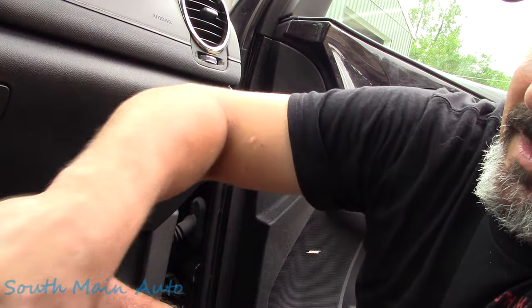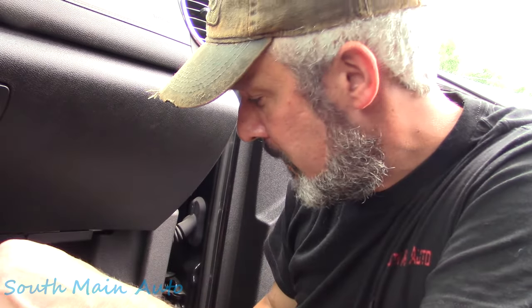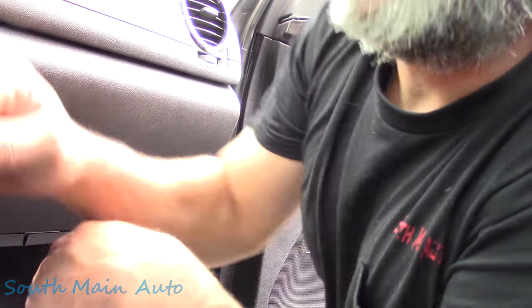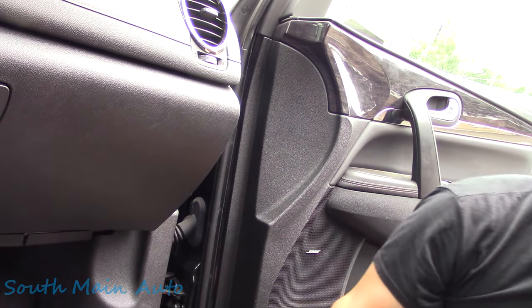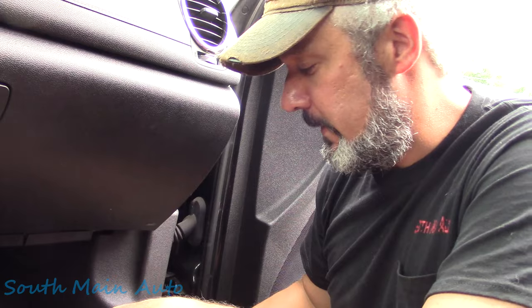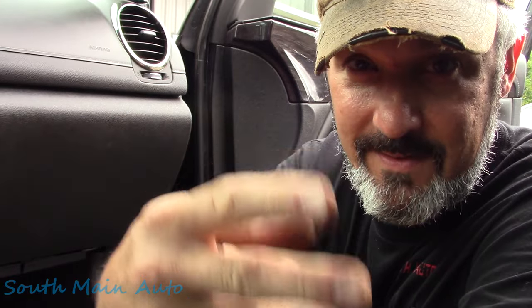Turn this on, put her on fresh air — there we go, good flow. So I remember taking that old Chevrolet after the 4.3 to 5.7 conversion, got it all done, was so proud of myself. Hammered right on it and of course the six-cylinder tach in it tacked right out when the V8 was only at about three grand — bouncing off the rev limiter. It took me a while to figure out that on the old throttle body engines the rev limiter is in the cluster, so you have to change the cluster to a 5.7 vehicle's cluster. Anyway, the blower motor's fixed. Go down and leave comments, find us on Instagram, Facebook, Patreon, and T-shirts on Teespring — if I can do it, you can do it. Thanks for watching.